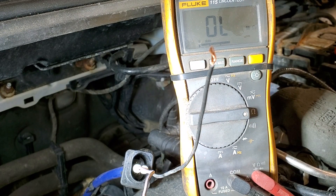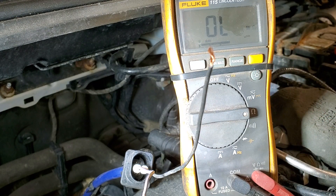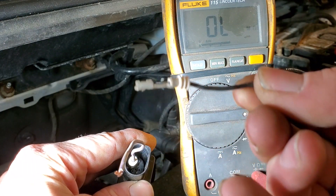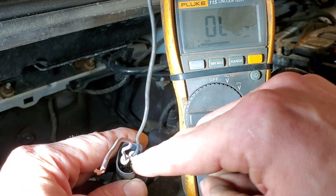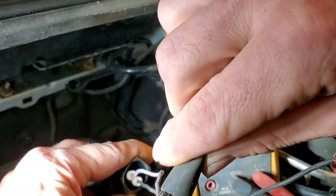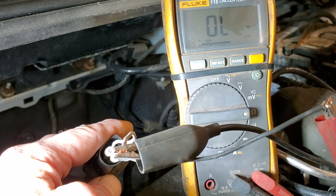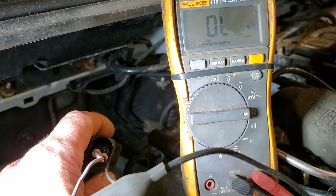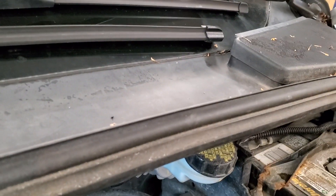Now we've got the meter set up here. Check our equipment, make sure our leads are good. I've got these two dummy wires in there — just some wires out of a pigtail so they've got a female terminal I can push down in there. I've got the two middle wires of that connector for the heater — one on there, one on there. No continuity through that. Right there, we know we've just got a bad heater, so everything else should check out as far as the rest of the circuit.